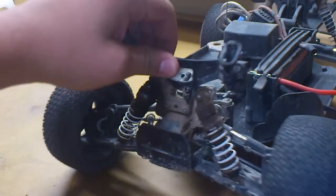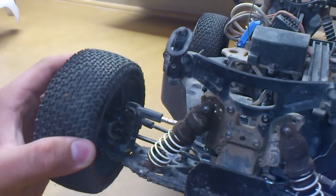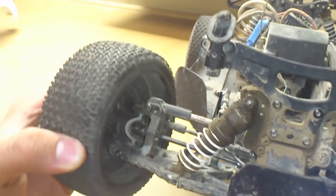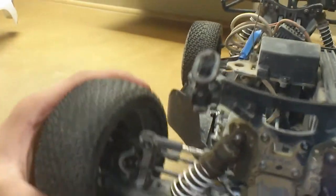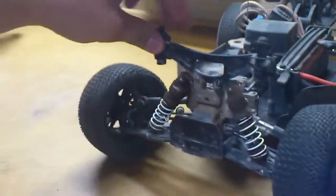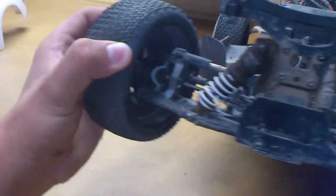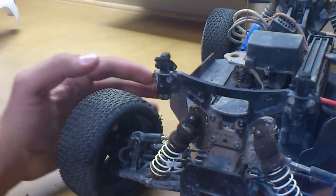As you can see, it's kind of dirty. The front shocks don't work so well anymore — the seals and O-rings are gone and they're just worn out. They're quite old, so the two front ones have been leaking. There's basically no oil in them; it just springs back instantly. I'm going to get those replaced, not quite sure what I'm going to go with, but something good.